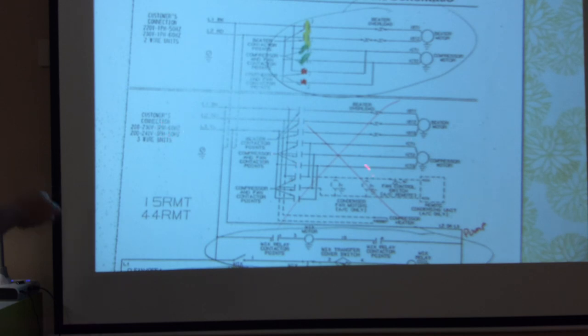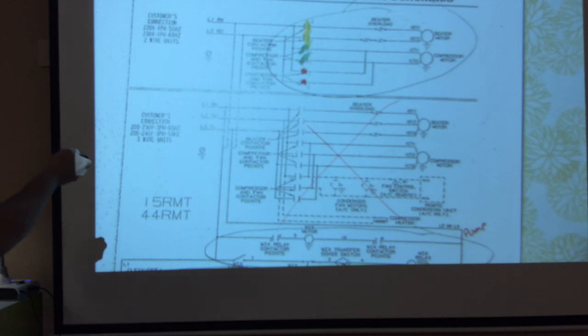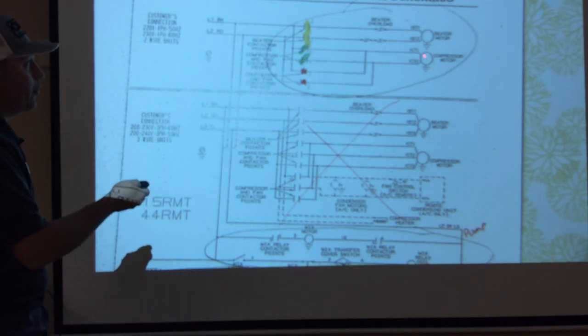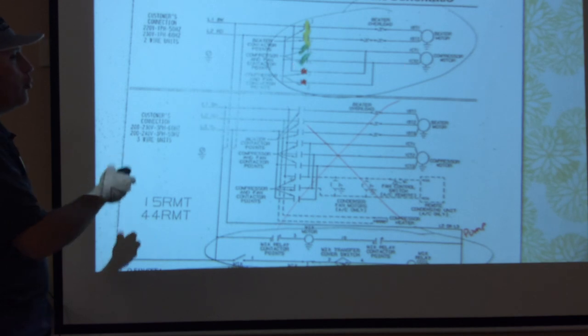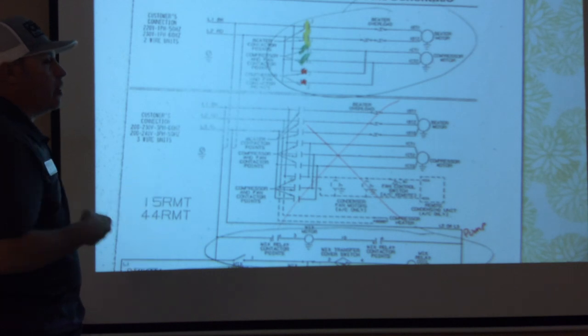It's a 220–230-volt, 60-hertz machine, non-three-phase — so we're using single-phase. This looks a little complex right here, but basically this is just the contactor section. The beater contactor contacts would close and bring on the beater. The compressor and condenser fan contactor would close these contacts and bring on the compressor. But this configuration right here — two different contactors could bring on this compressor — is needed because either the cabinet needing cooling at night or someone pulling down the handle to dispense ice cream could bring the compressor on.